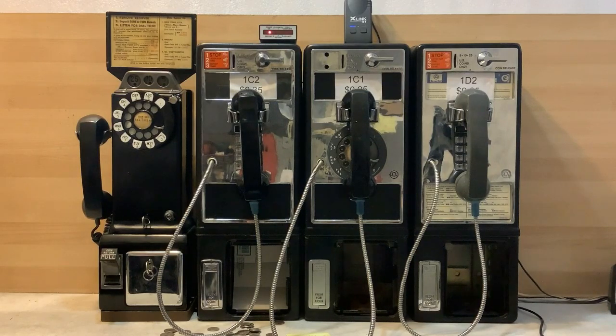After this time interval, the controller disables the payphone's dial. Now, I'm going to demonstrate dial tone first by dialing 3-1-1 on each of these single-slot payphones. 3-1-1 is a helpline for all the municipal services where I live. I'm going to keep dialing digits after the initial three, while the call is being connected, to demonstrate that the payphone's dial has been disabled by the controller.